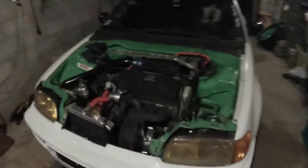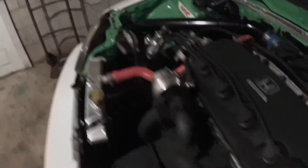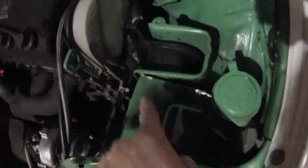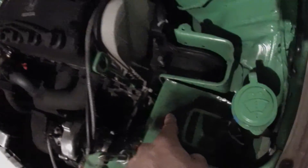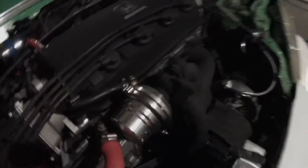I've already got my new motor in, so I'll give you a little shot since I don't know if you guys have seen it lately. I polished the turbo up — it's still the same turbo. Turbo blanket, got the wastegate pipe ran straight down, shoots the fire right off the ground. Good old cast iron log manifold. Intake pipe ran up with my custom heat shield, which I can actually show you guys how to make one of these. I still need to do that — I made this one, it's kind of all beat up now because I've taken it off so many times to clean my filter. My induction pipes, which you've probably seen on the other video. I'm going to get a bigger fan and relocate the radiator over a little farther, but for the all-motor setup it'll be fine.